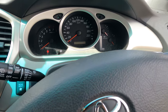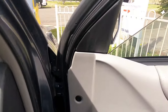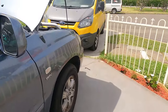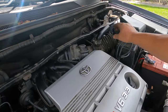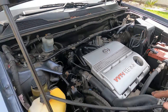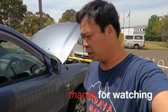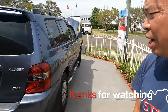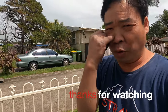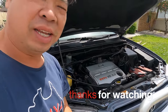Now we turn it off, the engine light is on, and then we start — beautiful. Now let's check that all connections are in and everything is perfect. Everything is in place: direct power fix done, new throttle body installed, and it needs a service soon — but that's it. Thank you for watching Simon Tools. That's how you replace a throttle body, fix blown fuses from a reversed battery connection, and fix the Toyota Kluger 2006. If you connect the battery the wrong way around, you get a power surge and burn out all the fuses and some electrical components. We found it, we fixed it, and it's good to go. Thanks again — see you!